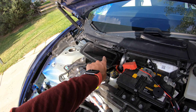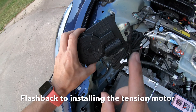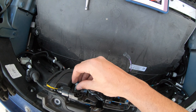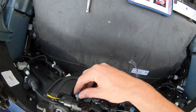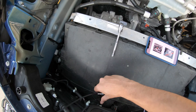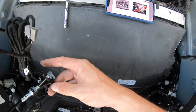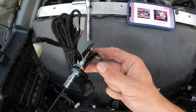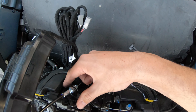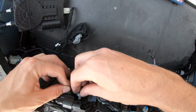One strut I routed up and behind the HVAC system and over the battery. Now that I have all of this out, I'm able to move on to the tension lock here. This is a pretty interesting thing — there is a bolt in the regular locking mechanism, an 11 millimeter bolt. You pull that out. With this piece, you are able to turn it 90 degrees, and there is a little piece right down here that you can slide in — it's a 90 degree angle, couple pieces put together. You put that in, rotate 90 degrees, and it lines up right in place. Then we can pop the screw right in.